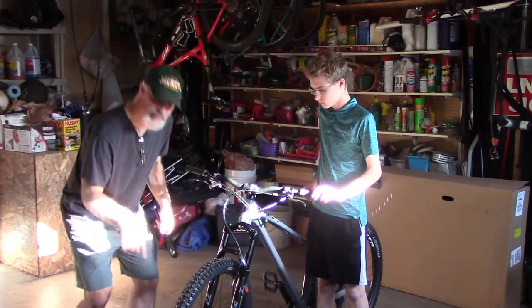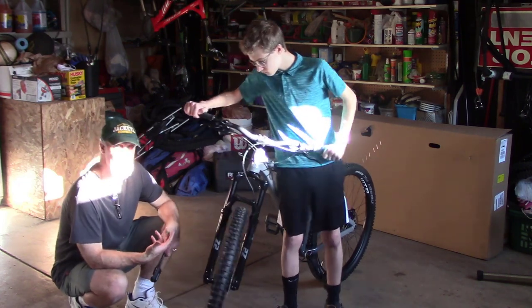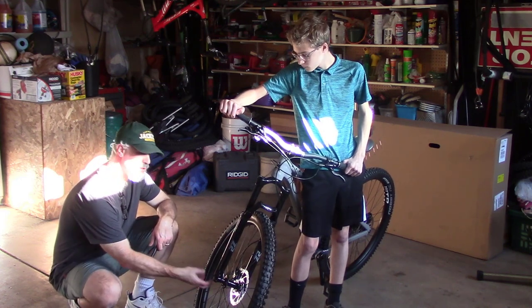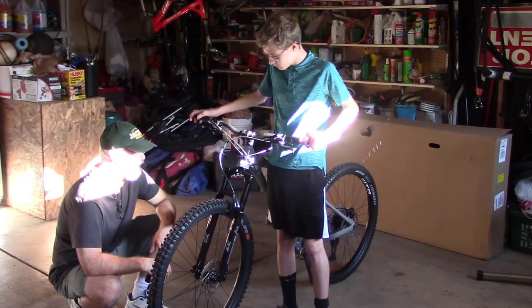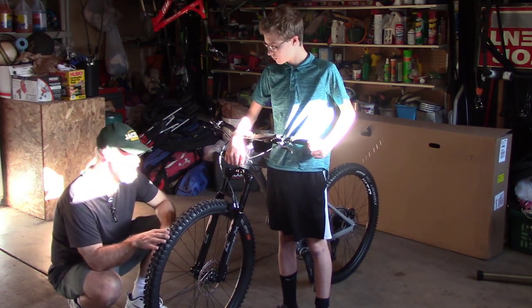And then down here, we've got the rebound, and for his weight, it gets 17 clicks out of totally closed, which is almost completely open. And that's good, so he's ready to go for his weight. I am gonna do the sag, the actual sag though, for him, and you might consider that.